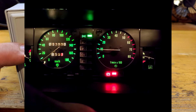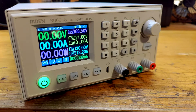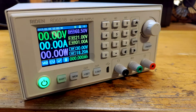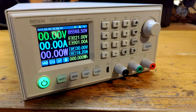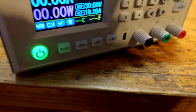If you are familiar with why old computers and oscilloscopes had green-to-black screens, you may know where I am going. The human eye can most easily recognize green. Therefore in many cars you've got green backlit interior, before white backlit fashion took its place. If you are thinking about red backlit, that's because you can't be fully blinded with red. So any color like green, yellow, orange and red is okay — even white — but this purple, well, it is still better than blue, but not that great either. You have to focus more on this purple than on green. The display, however, has almost perfect viewing angles, so you can see the value from any angle absolutely nicely.